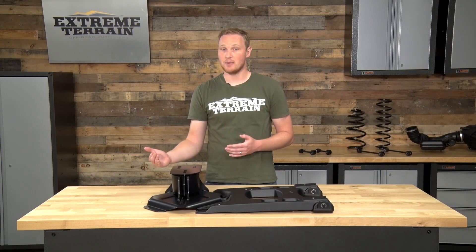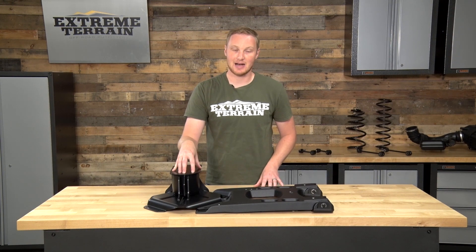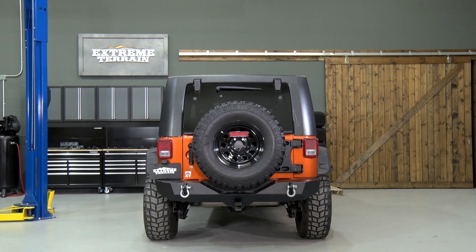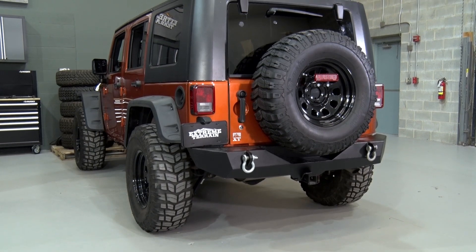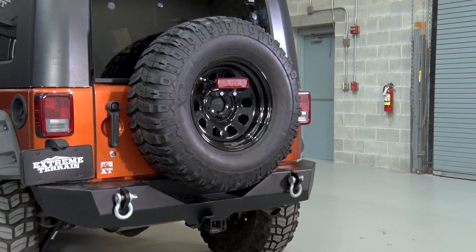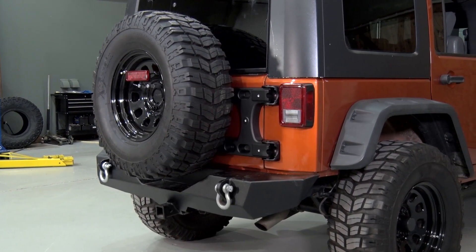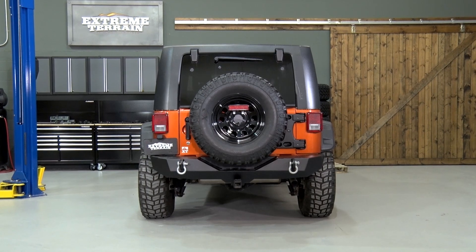I like to run my tire as low as I possibly can to give me maximum viewing out of the back window, but it also needs to be high enough to not contact the bumper when you open and close the tailgate. So the up and down adjustment gives you the ability to set it exactly where you want it. The in and out adjustment is very important, because if you have the tire sitting way far out from the Jeep, there's a ton of leverage out there which can fatigue the metal, and it'll also move and bounce around. This allows you to slide the tire nice and tight up against the carrier and bolt everything solid so the tire, the tire carrier, and the tailgate all become one piece. Nothing can move, nothing's gonna rattle, make noise, or fatigue.